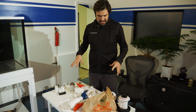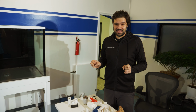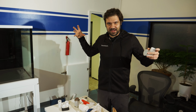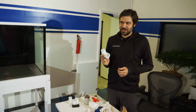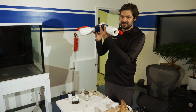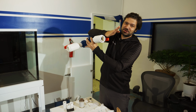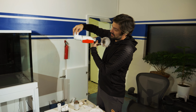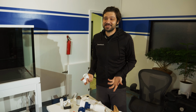Alright, so we have a lot of the pre-assembly put together. And right when we were about to do the final test fit, it's funny how much time I spent doing thought experiments of how the plumbing was gonna come together. I thought it was gonna be super slick and tricky and use fewer parts by using these street elbows that would go straight into the bulkhead, saving space. But then it turned out that the way that the pump has to attach underneath the tank, there just wasn't enough clearance from this valve to get into the street elbow, right? So the street elbow is kind of fixed position, but because of the brace right here, it was matching up like that. So it's funny because then you backtrack and do a much, much simpler solution.